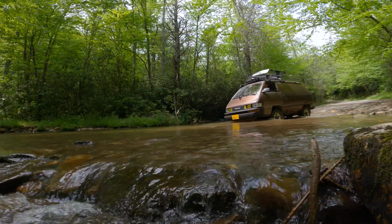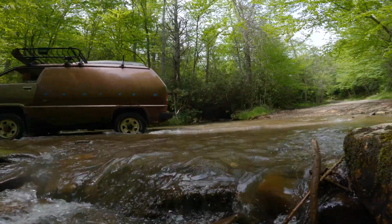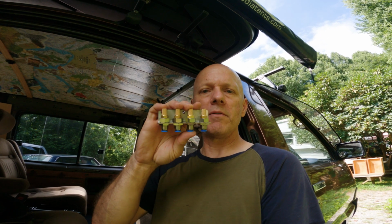That being said, if you're doing a river crossing and you're in 4x4 mode and you're in the outback, when you get into that cold water, if your pressure changes in such a way that it creates a vacuum, then the water from the river can be sucked into your axle. Those oil seals at your bearings are meant to keep oil in the axle. It's not necessarily meant to keep water out. So that's the whole reason for putting these guys up above the water line.